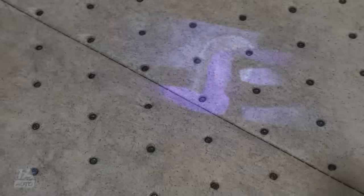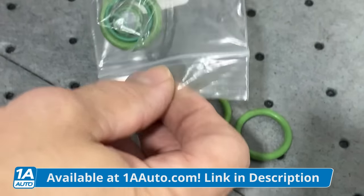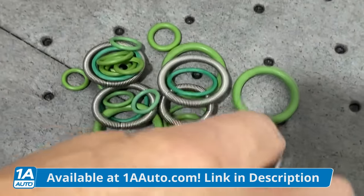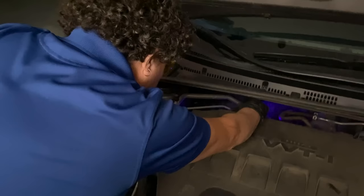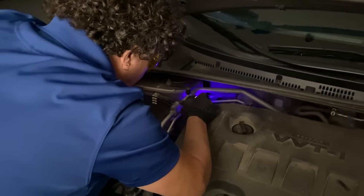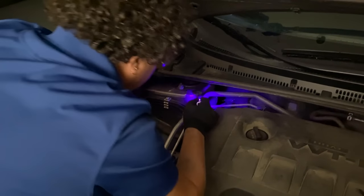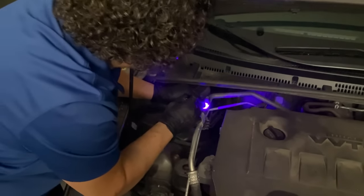The UV dye tells you that's probably going to be O-rings. So if I'm going to do repairs on the system, I'm definitely going to replace the O-rings here on the hoses going into that evaporator, and I'll follow them around. I want to make sure there's no kink in the aluminum lines, no cutting, and I'll pay attention wherever the Schrader valve is — because sometimes right where the factory builds that weld, I've seen those crack.